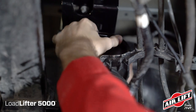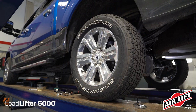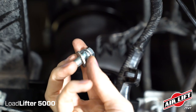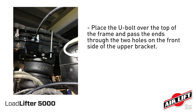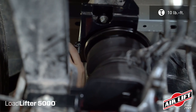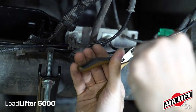Place the last two roll plates on top of the air springs, making sure the mounting holes are lined up with the threaded holes on the air springs. Raise the axle enough to allow the top of the air spring to move around a bit. Install the mounting hardware attaching the air spring to the upper bracket and thread the hardware finger tight. Place the U-bolt over the top of the frame and pass the ends through the two holes on the front side of the upper bracket. Thread the serrated flange nuts onto both sides. Torque the mounting hardware on the top and bottom. Zip-tie the wiring harnesses and ABS line out of the way to avoid any rubbing.